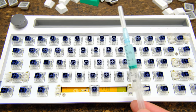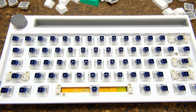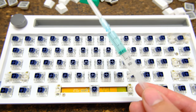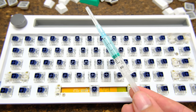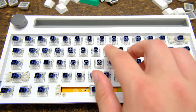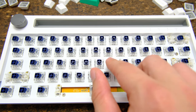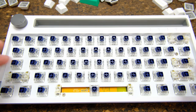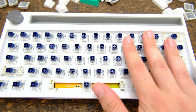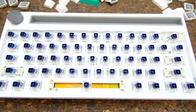I just did the entire board - as you can see I used about half a milliliter for an entire keyboard. The trick really is to use as little of this stuff as you need, keeping in mind that most of this is just going to evaporate, so about half a milliliter will maybe be 0.2 to 0.3 milliliters of actual lube on your switches. When you're done, basically you just need to shake your board a little bit, then cycle the switches as quickly as you can before the lube starts drying off, to distribute it as evenly as possible, then just let it dry. With some boards you can put them upside down and press them down a little bit. With this one I'm just going to put the keycaps on, start typing away, and in about 10 minutes this board will be ready.